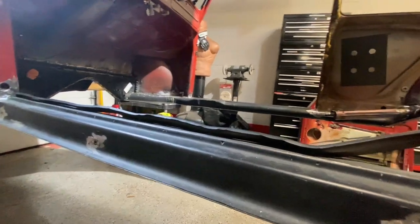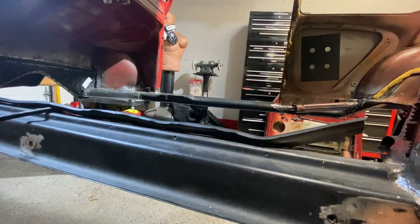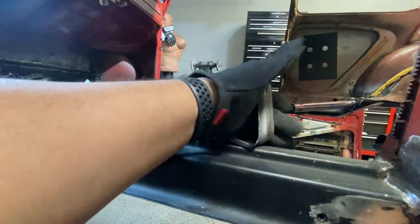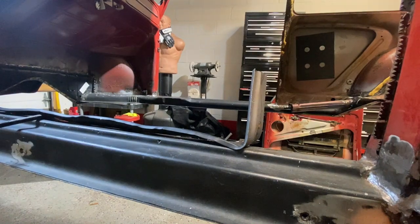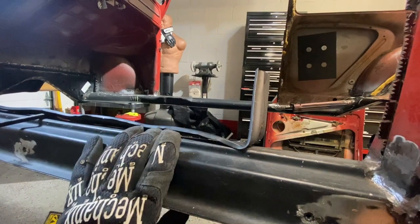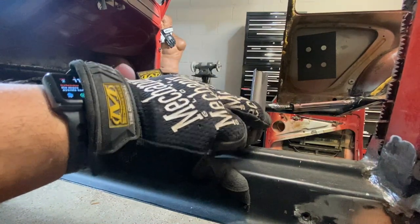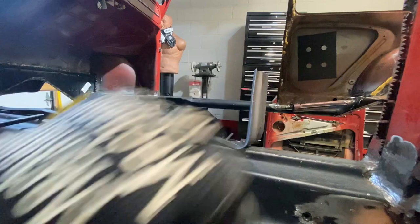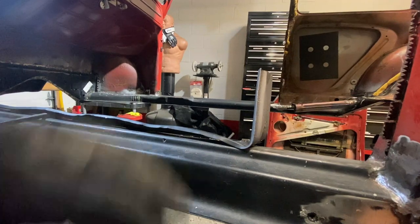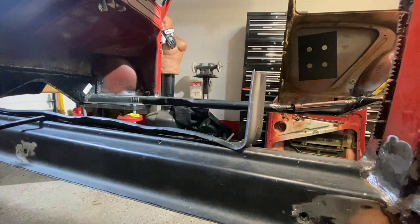Just give me an idea here — if you look there, it's not spot welding on the end. Pull that back. I also want to show you that you can see it's not painted underneath there. So if you're going to use this and plan to paint the car and make it look nice, be sure that you paint this too, because eventually this will rust out. Moisture gets in here — whether you're driving and it rains and you're stepping through here, water will get in. Let me grab some stuff and start taking this off.